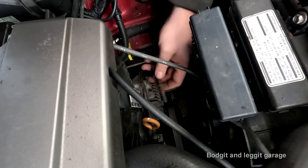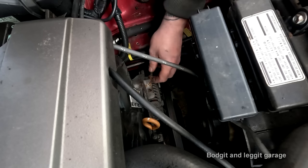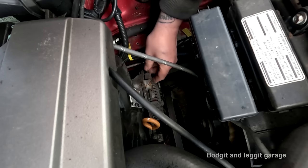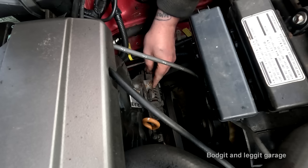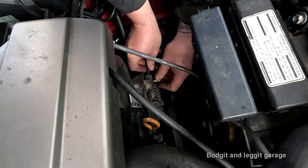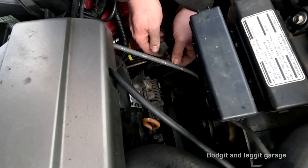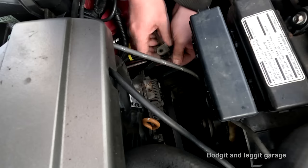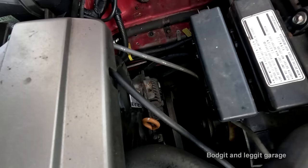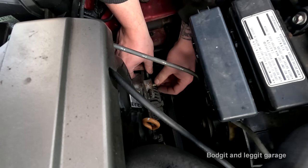And you can see here is our tensioner. So when you screw this, this slides up and down and allows the alternator to go up and down to basically tension it. So I've now got to screw this in because it's not going to line up where it originally did, because the belt is new. I don't know exactly where it is, to be honest. Oh, it seems like it's quite a long way up. Let's hope. Oh yeah, it's right at the top, so lucky enough I can see the hole, because sometimes you get a belt and they might have given you one that's slightly smaller but it still technically works. Just makes your life a lot harder.